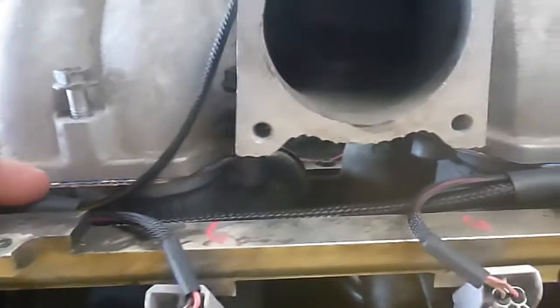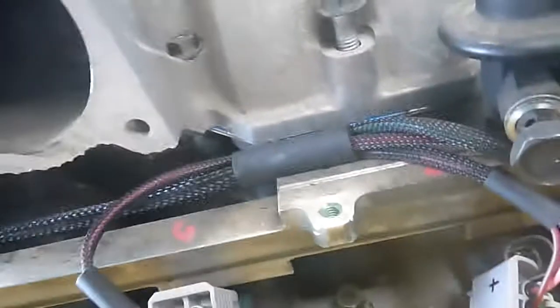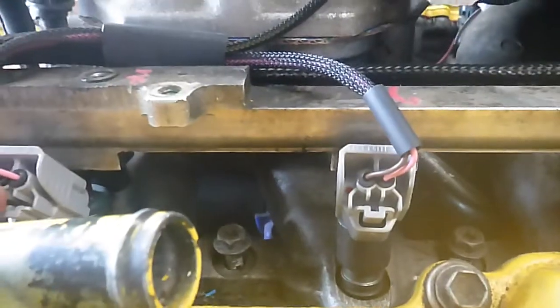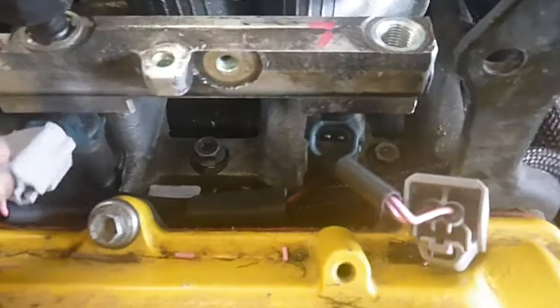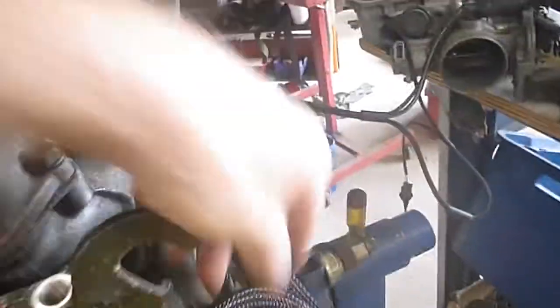On the other side, it would actually tuck on the inside of the fuel rail if you want, which looks really neat and tidy, tucks it away, then cable tie it on. That looks really neat and the injector wiring is long enough to come over the outside. You can also tuck it on the outside if you want and P-clamp it on the factory mounts. Injector plugs come up. I think that looks really quite neat — three different ways, it all fits.